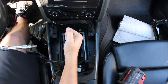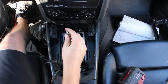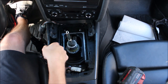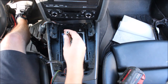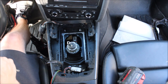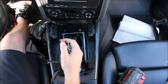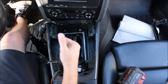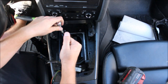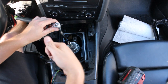My preferred way is to hold on to this thing really tight while I loosen it, and once it starts to feel loose you're going to move it over. I can't access the bolt right now in neutral — it's underneath the shifter. Don't fret if that happens — you can go back to fourth gear and work your starting point over there, then come back to neutral and reevaluate once it's tightened up. It's actually nice to adjust the linkage when it's in fourth because you have a really firm grip on it. Remember I need to get farther to the left — so I need to move my starting position to the right.